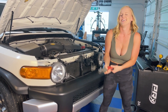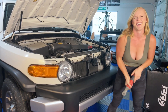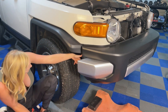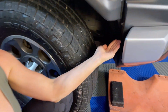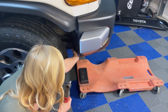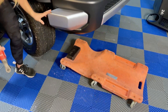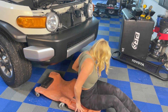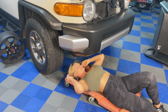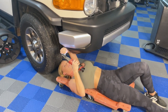Two hands — it's a two-handed tool with room for more, and we're going to be breaking some nuts today. I'm going to go ahead and show you on this side first what we're doing, because it's identical on either side. I've got two 10 millimeters here and here. We've got one directly underneath, so you don't want to forget about that guy, and then several others along the front — identical on the other side. Once we get these nuts off, we'll be ready to take off the bumper. So I'm going to get on that fun little creeper, put my hair back — I don't want to roll over it, I've done that before. It's not the time to pull hair.